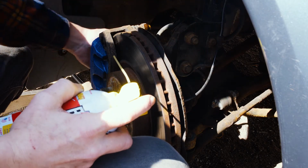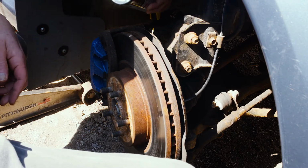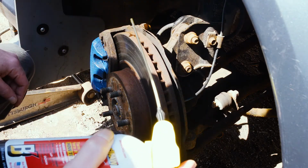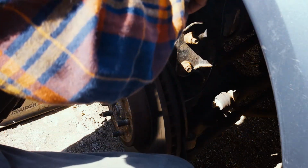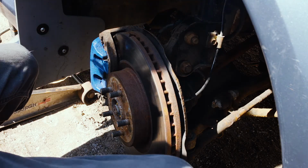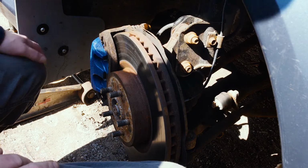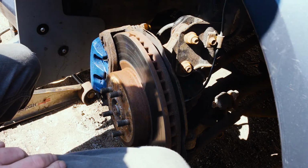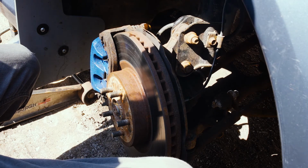This is going to be really the same as changing your brakes. So we're going to do one caliper bolt down here and one there, and then the two bracket bolts as well. And they're right there, so easy enough to see. Then we're going to wait probably 5-10 minutes, 15 minutes, and then we're going to go back and bust those bolts loose and take off the caliper.